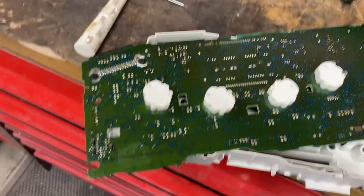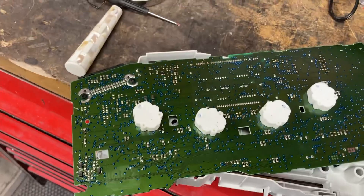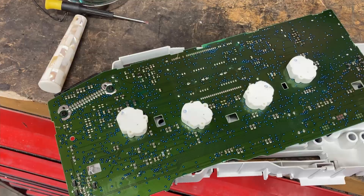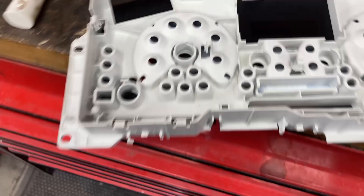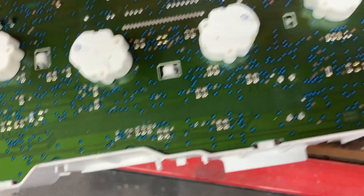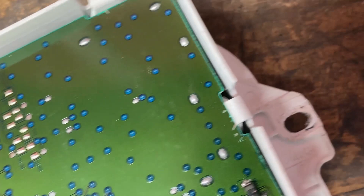Reassembly is just the opposite of disassembly. If you haven't watched the videos on how to disassemble this Crown Vic cluster, here's how it goes in reverse. That's your component side and that's the back side of the gauges. This is held in by a series of clips around the border and a couple in the middle, and it basically just snaps in.